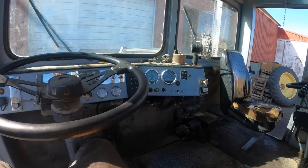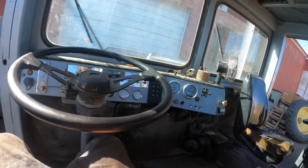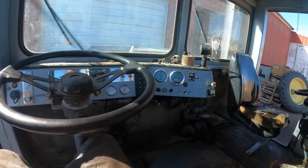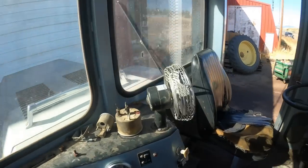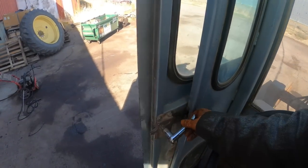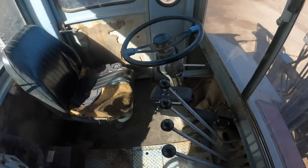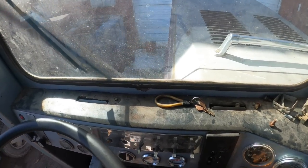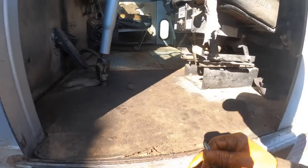She sounds really good too. The only thing that's not done like it should be is the speedometer, because I looked and looked on his rear end and I set the revs per mile for the tire size in the ECM, but I can't find the gear ratio tag on that rear end, so I left him a message. Guys, this has been a real go-around, but every project after this is easy — let's put it that way. And I've got another one in the shop already, and another one coming after that, supposed to be here in the next couple days.